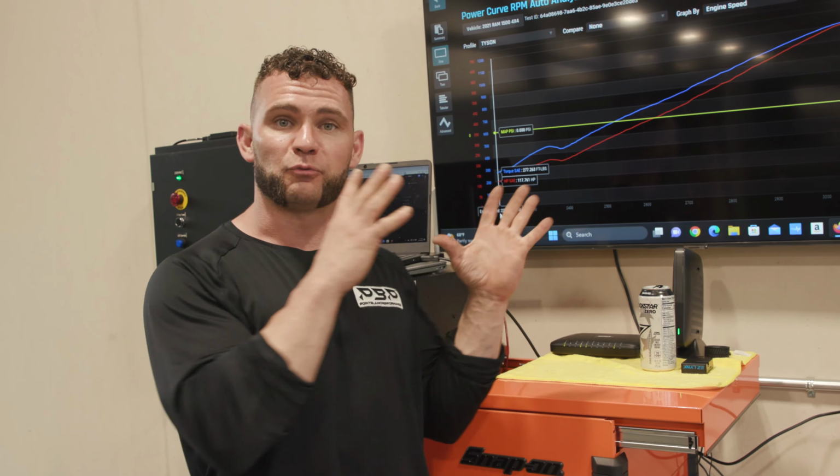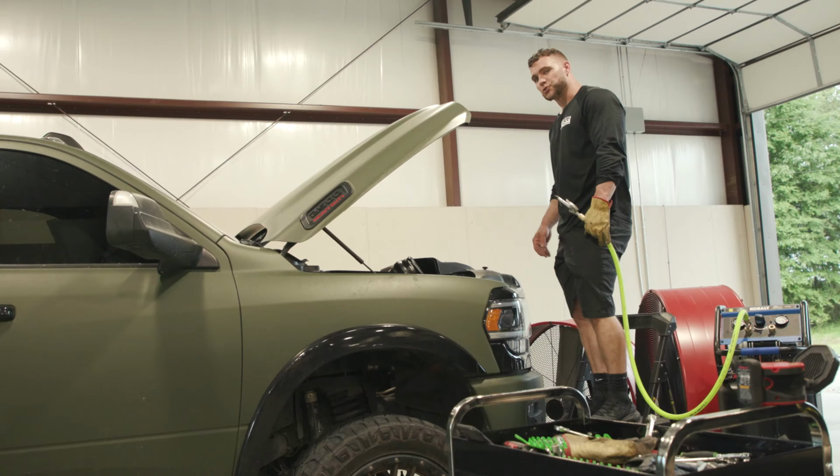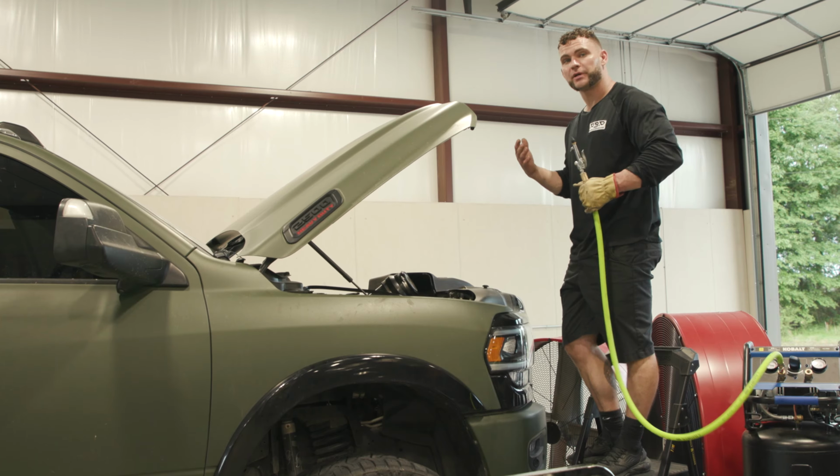So I've reviewed the EFI Live data, I've looked at it, I've seen how much fuel's there, our rail pressure solid, 29,000, 28.5, I'm happy. But is there something underneath that hood that is robbing us of horsepower? So guys, if I'm up here, what am I doing? We're doing an old faithful boost test. Why do we boost test it?